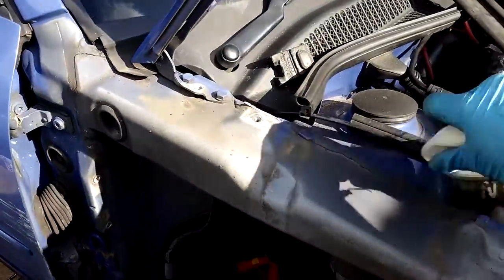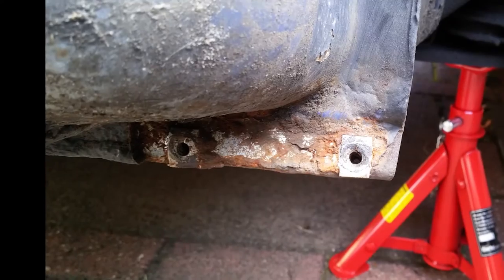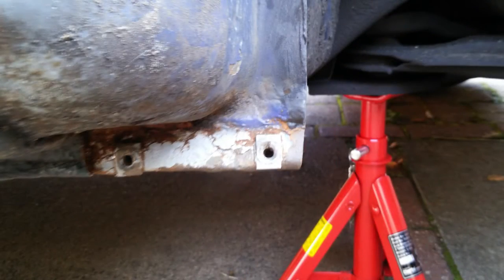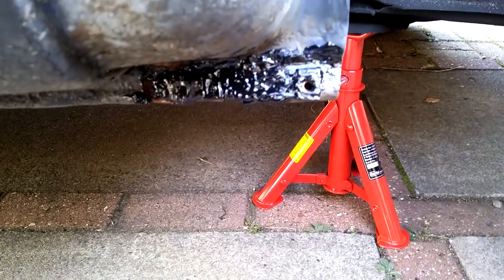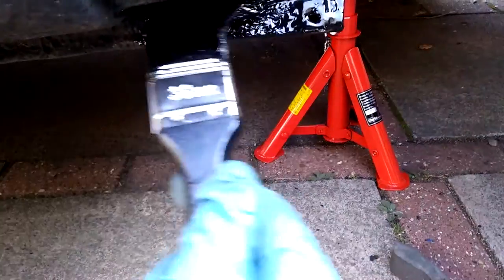You might want to add some heavy-duty paint because you're not going to see it, but you want to protect it. There are years of dust built up here, so I've gone over it, cleaned it all up, and found rust on the inside where the dirt built up — so I'm going to use a brass brush. I've sped this up but I'm taking it all the way back to bare metal as much as I can to stop the corrosion. Normally I rust-convert stuff but this was a bit unexpected, so I just brushed it back and used chassis paint on it — just to seal the rust in from both sides so it doesn't spread up to the rest of the bodywork.